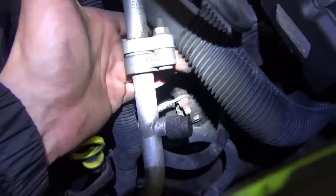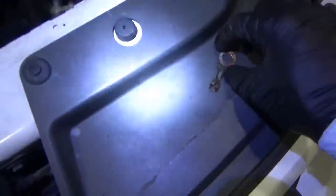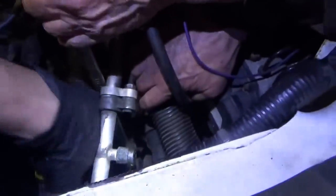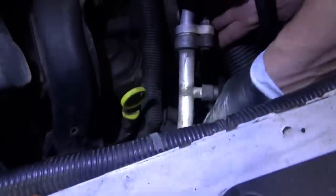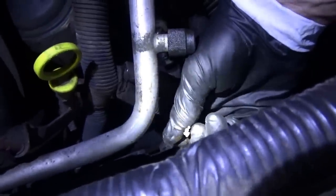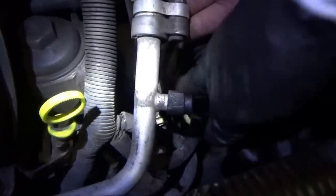We can fix it up — unscrew that nut, spray it down, tighten it up. And there's your problem — it just came right off with no effort. Even if we were grounding one of these wires we'd need to ground all of them for a proper bypass test. We can't jump the gun. We have a little pigtail of five wires — really crusty. We'll have to clean them off, put a new eyelet on, crimp it, clean up that mess, then do a real check.